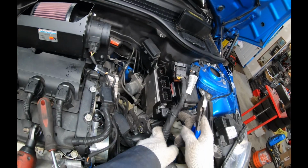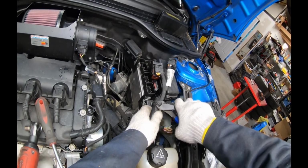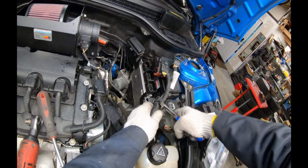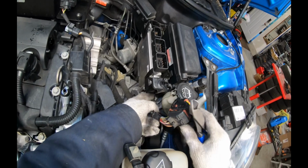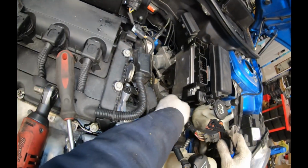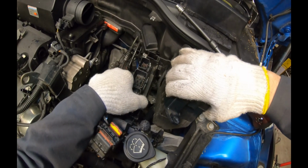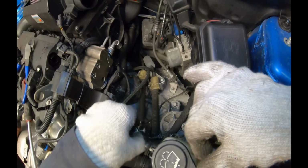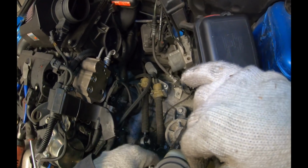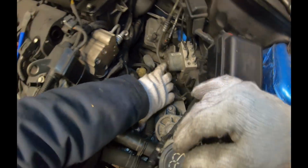There's a couple of harnesses attached to the box. I typically use a side cutter to cut off the zip tie, and then we'll replace later. There's another clip on the front here, and then also the reverse clip is on the bottom of the box. Then we can lift the bracket up and out. Hopefully we don't drop our screws. So that gives us really good visibility into the work area. So we're going to need to remove these shift cables. Down here is the reverse switch.